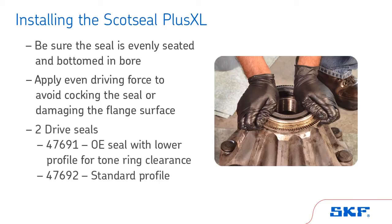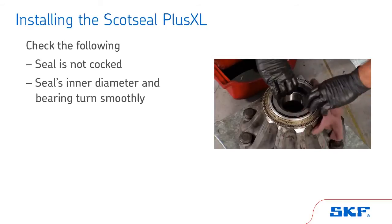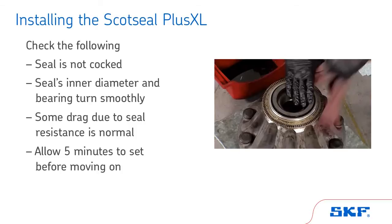Note, there are two drive axle ScotSeal Plus XL seals, 47691 and 47692. The 47691 is the OE seal and has a lower profile for greater tone ring clearance. Check to be certain the seal is not cocked, and also check that the seal's inner diameter and bearing turn smoothly. There may be some drag due to the seal resistance, and this is normal. Allow 5 minutes for the rubber to settle in the hub before installing the hub assembly onto the spindle.